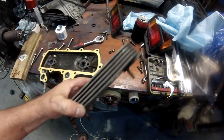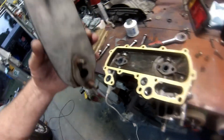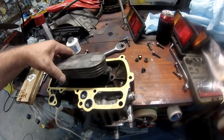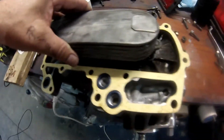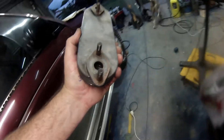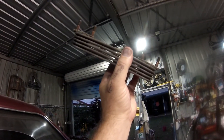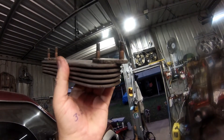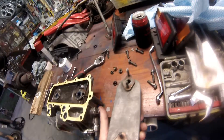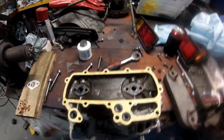This is the veins inside - this is where the actual oil will come out that hole, in that hole, out that hole, and go through that one back out - so that filters it. Around the outside is the water chamber, so water runs around the outside while oil is in the centre. There are veins inside - each one of these plates you can see through is actually hollow in the middle, and that's where the oil runs through pressurised. With water around the outside, it's helping cool the oil. Just make sure you check your gasket kits before putting this on.